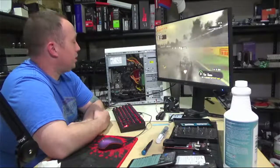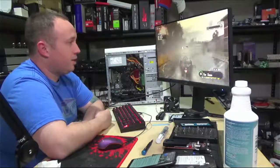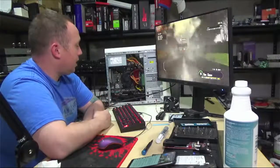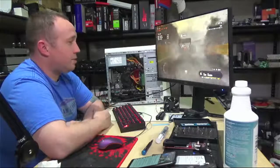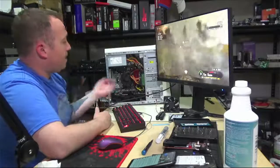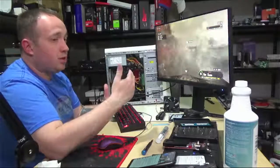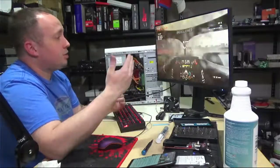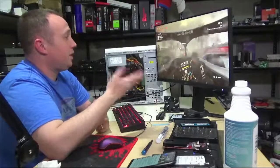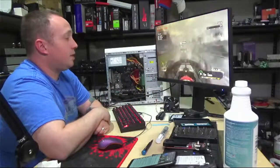So I took it. I spent about $20 on fans from eBay to replace them, because almost all the fans, 2 of the fans were totally dead, and the last fan was dying. So that $20, cleaned it up, repasted it, changed the thermal pads. So let's call it $25 in materials for that graphics card, and that allowed one entire resolution bump plus 2 tiers of graphics quality on this one game. This is like one game, but yeah, that looks great.